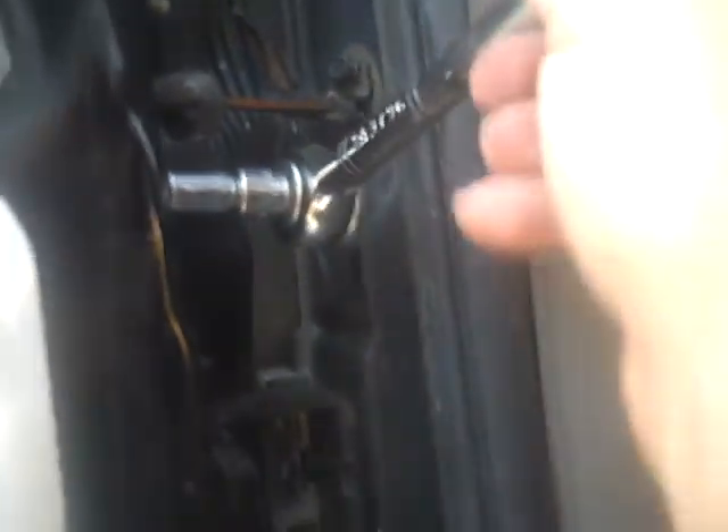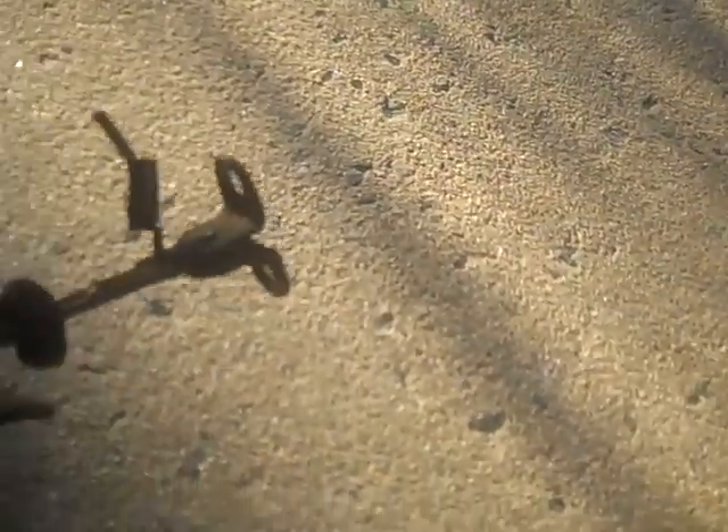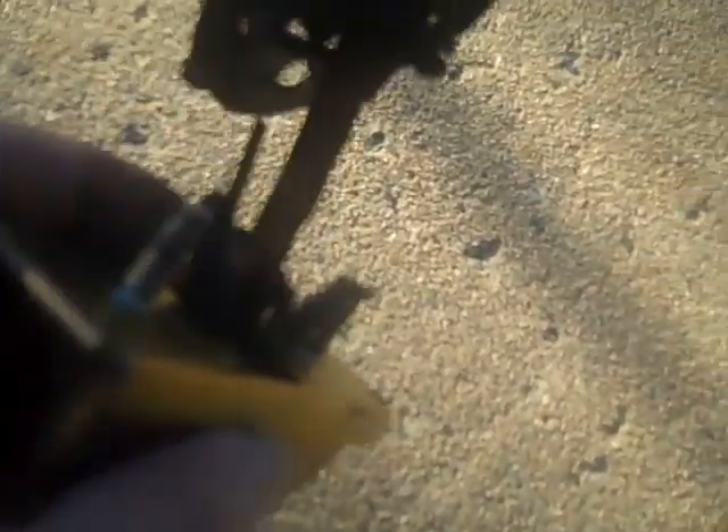This unit should pull into the door and I'll manipulate it back out through the speaker hole. All right, so I just pulled the door check assembly out — this is what we have. You can see how the coating around that metal shaft just corroded and ripped itself apart over time. Here's the new one: ripped and destroyed versus nice and clean.